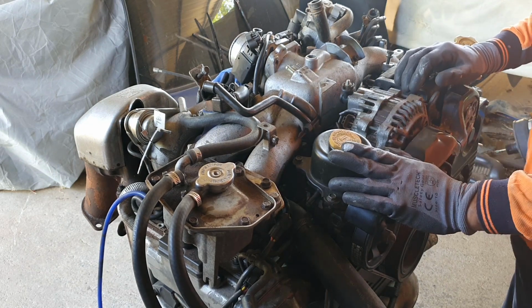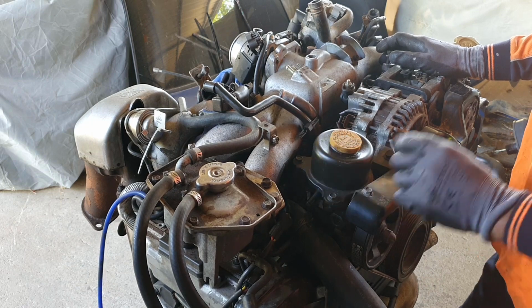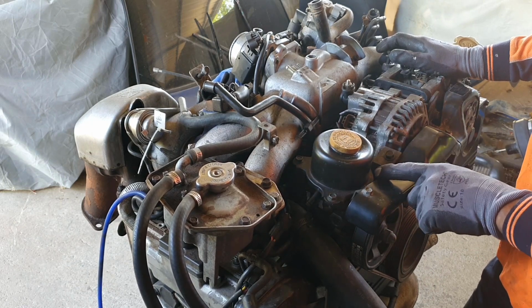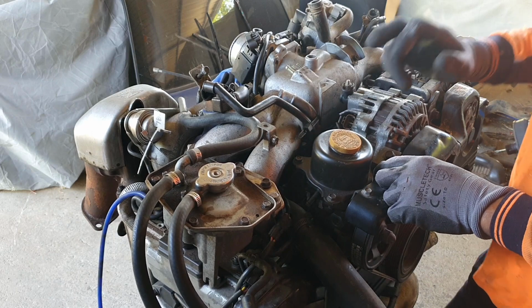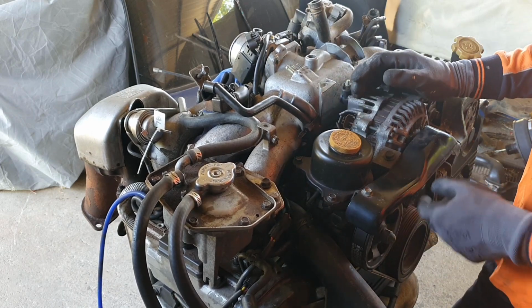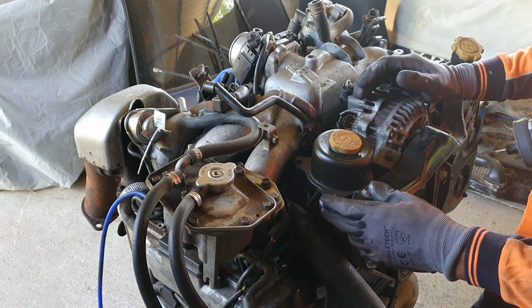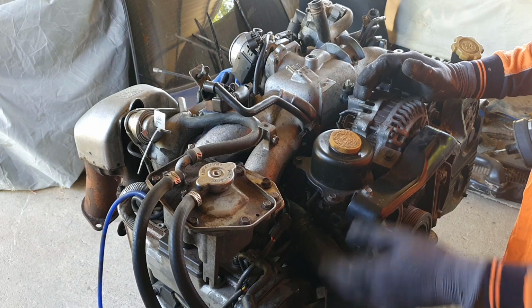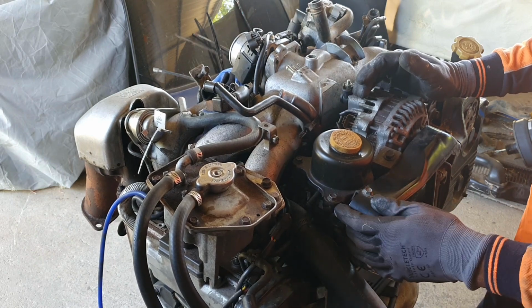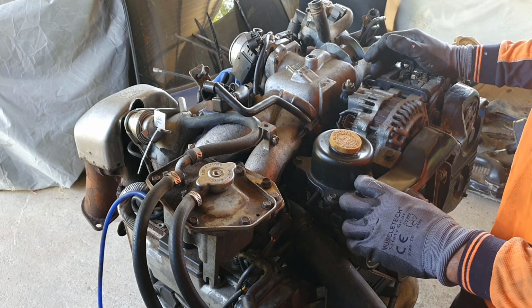The power steering pump on this was also very noisy when it was in the last rally car, and the tank on top is actually dented. So I'd say that in the rollover that's copped a knock, or maybe when it got pulled out of the car, one way or the other that's going to go. I'll actually put a later model power steering pump on it, and I'll use the later model lines, because the power steering lines also changed on these to suit the pumps and the inlets and everything as well.